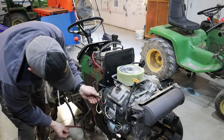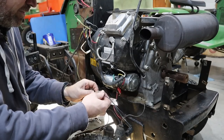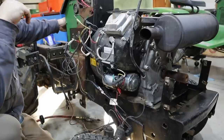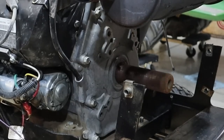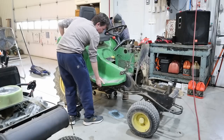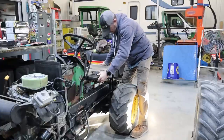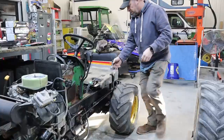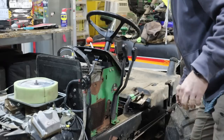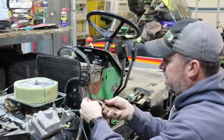I frankly don't know what I'm doing, but I can hear my starter improvement kit clicking. I don't have any signal going to the starter yet — this wire would have been connected to it. Now it cranks. It doesn't have any gas hooked up yet. I'm going to lift this fender pan off — it kind of slides up and back off. If it fires, I should have the ignition hooked up right. I haven't got the throttle or choke cable hooked up, but those I can do after the fact. I just want to make sure this works and that nothing leaks or needs attention.